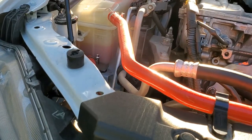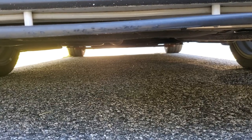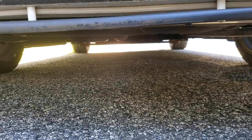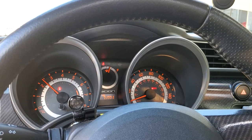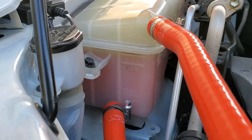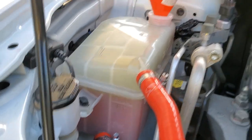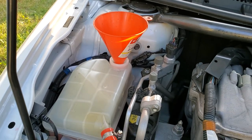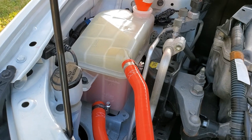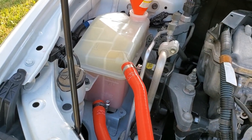I've already noticed that the fluid is going down a little bit, so I'm going to go ahead and add some more coolant right now. With the engine running, check underneath the car to make sure there are no leaks. You can speed up the process of getting the thermostat to open by holding the car at 2500 RPMs. The coolant level has finally stopped dropping and it's holding steady at full. So I'm going to go ahead, put the cap back on, and then go for a five to ten minute drive, then come back and check where the levels are at. If they've dropped any more, I'm going to wait for the engine to cool down and then add more fluid. And if it doesn't, then we're good to go.